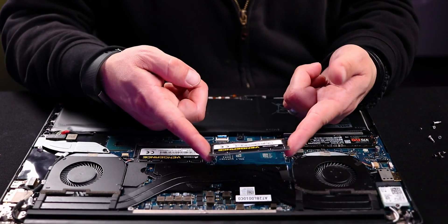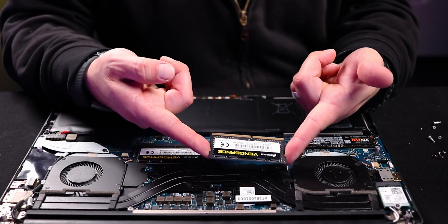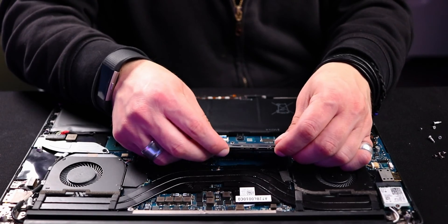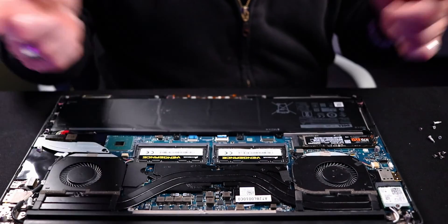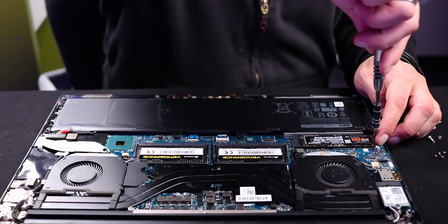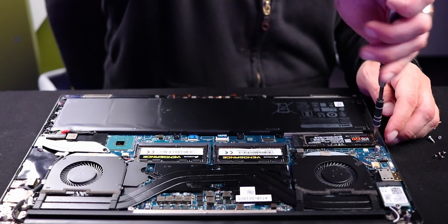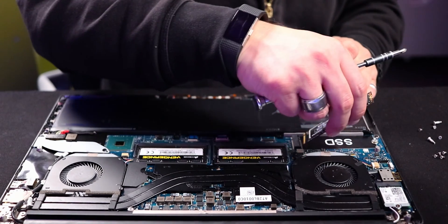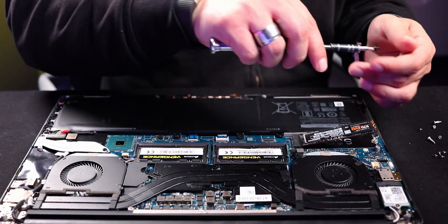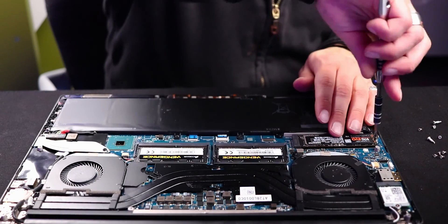Since the laptop's open — these two pieces of RAM, that's all you do to take them out. When you're paying somebody $40 to upgrade one of these pieces of RAM, all they're doing is opening up your laptop and removing it. You have two here. This one just needs a screw to release. You literally undo it, put the new one back in, and you're good to go. No complaints whatsoever — you can upgrade all this stuff, no problem.